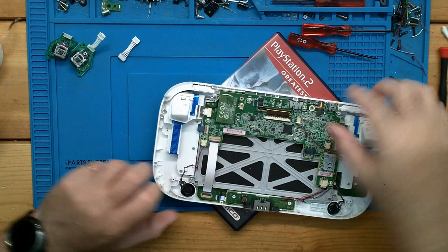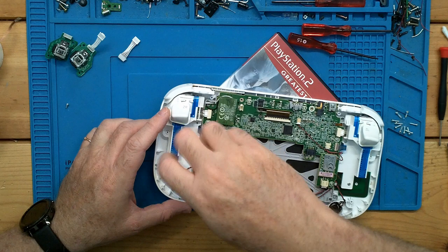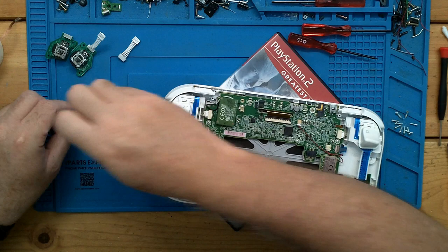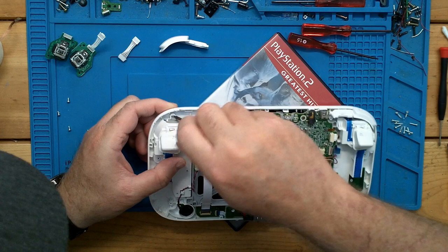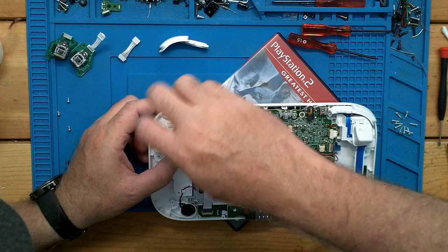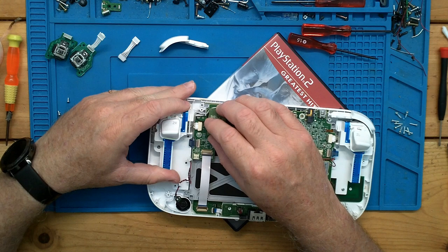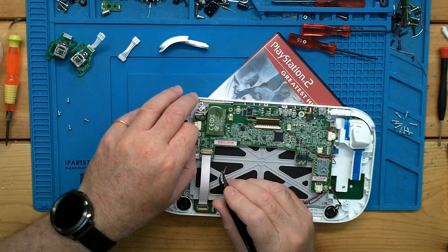Let's go ahead and get into one side of this. We'll turn the box a little bit diagonal so we can get some support under these screws. The rest of this is Phillips. We can set the button out — and as I thought, there was one more hiding up under there, past the little membrane button. There we go. Let's go ahead and wiggle this out. Once the screws are all out, you've got one ribbon here to pop — it lifts from the front like that. You want to lift up on it to get it out. This one has little ears that get captured, and it's out of the way.